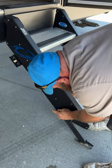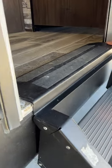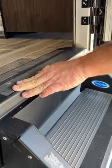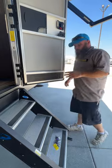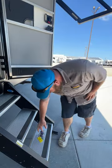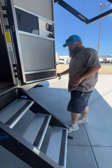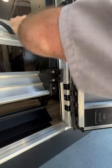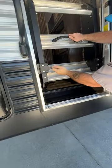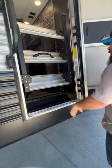The reason you have to adjust these feet is because you want the step as flat with the threshold as possible. Too much elevation can cause issues to both the screen door and entry door if you're not careful. To flip your steps up, you have to make sure you have the door open, push it back for it to lock in, and pull this to lock it into place. When the door is shut it keeps it locked in so it doesn't bounce around going down the road.